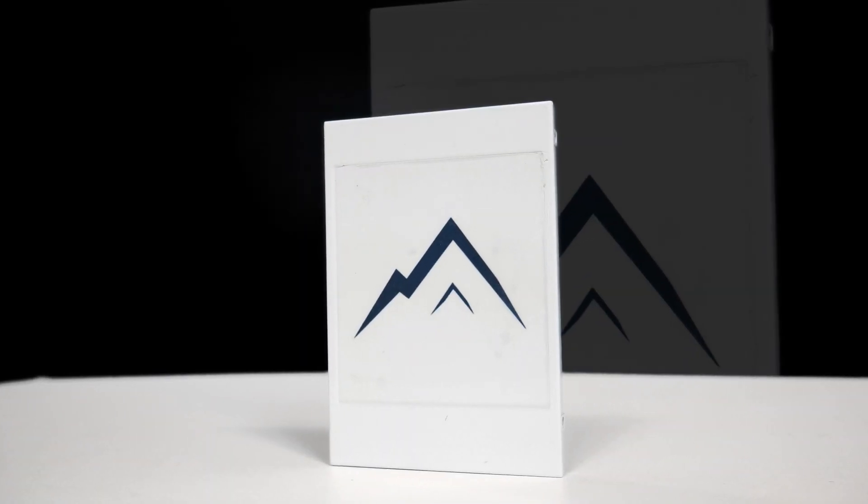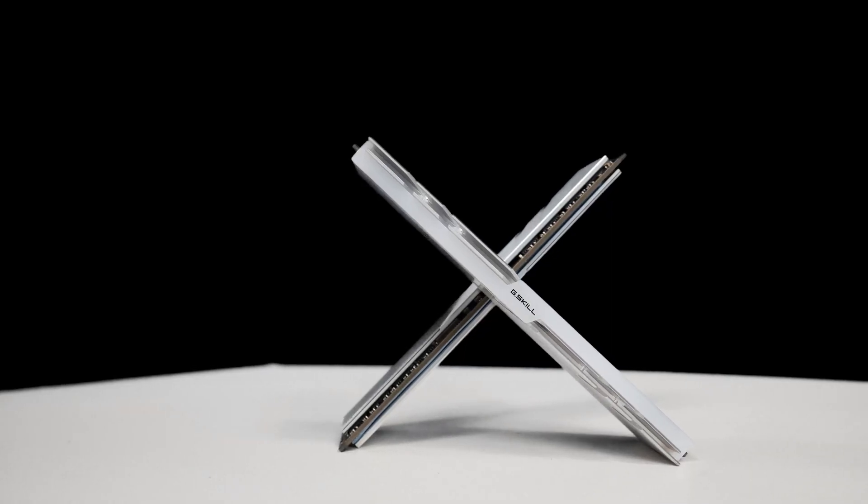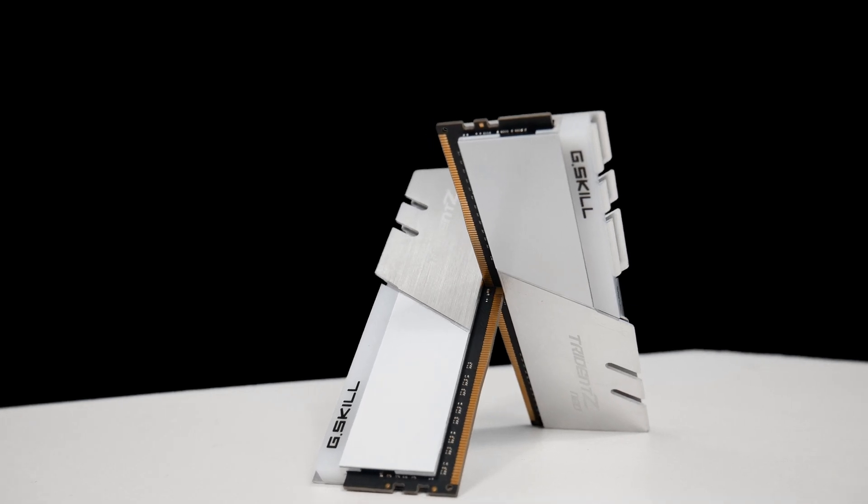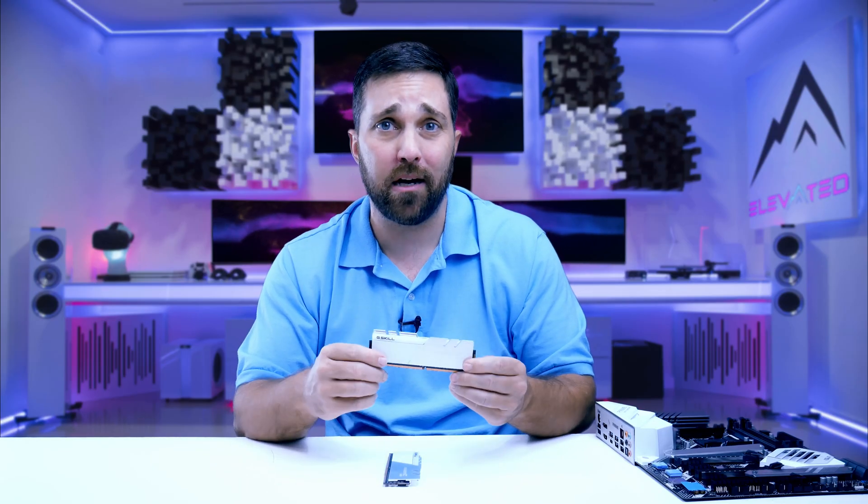The next simple mod was the 2.5 inch SSD. After I painted it, I replaced the stock sticker with a custom decal — I got a pack of clear full 8.5 by 11 inkjet labels and can print basically anything I want. I'll leave a link in the description below. Next is the memory — you already saw this but here it is put back together. I think this is the best mod I did this week; it just came out flawless and looks like it was purchased this way. Also, before I forget: earlier when I stripped these heat spreaders I was wearing gloves and goggles, but I wasn't wearing my respirator. When you strip aluminum with sodium hydroxide you definitely should wear a respirator — one of the chemical cartridge types. I'll be sure to throw up a 'don't be stupid like me' warning at that part during editing.